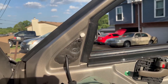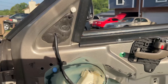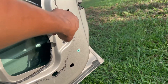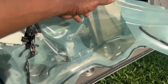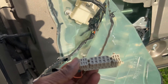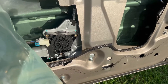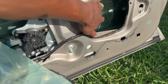Let me try to give you some semblance of what was supposed to happen. There was a sail piece right here — pull that out. There's a screw right here when you take off the panel that holds it, and there's supposed to be a screw over here on the side. Take that out, then pull this plastic shield after you pop all the clips and get it out. Then unscrew and unplug the window switches right here.